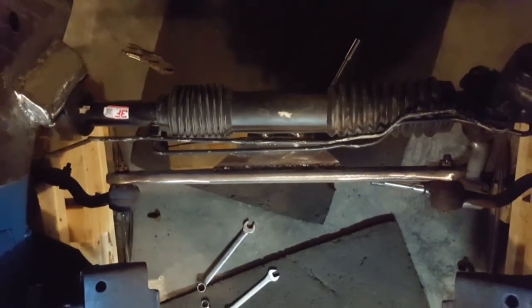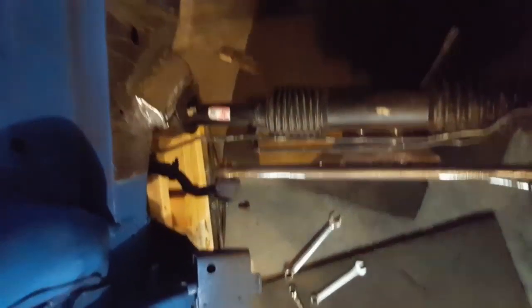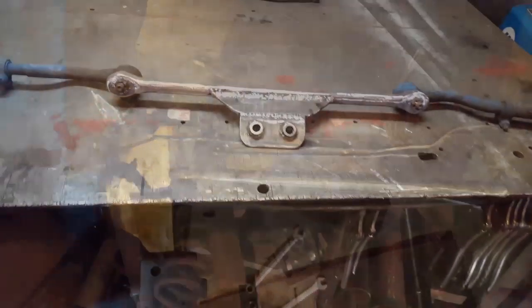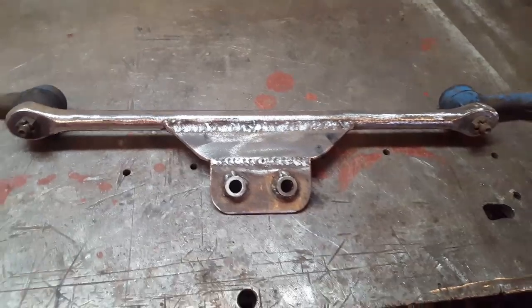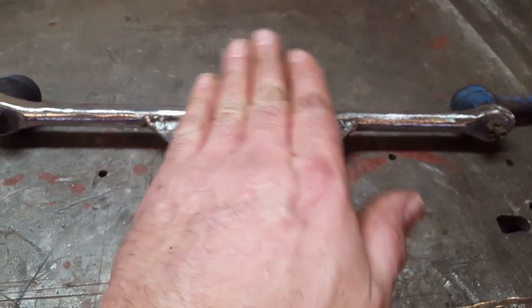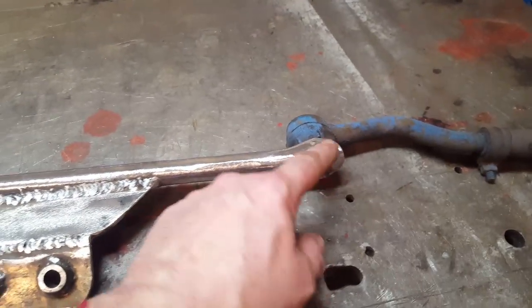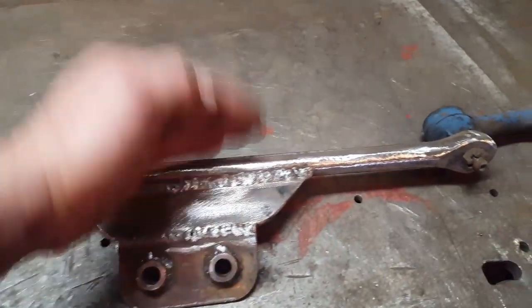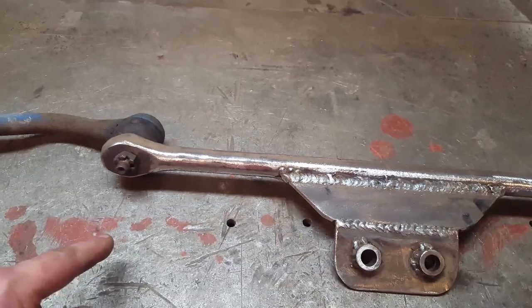You can see it deflecting and twisting. There's that center link that I spent lots of time on, but it's not working. What's going on is this is actually moving like this when you bolt it in the car - it's pulling from this bolt hole to this bolt hole, pulling this way. So this comes down the same way on the other side, because it's too far forward from this bolt hole.